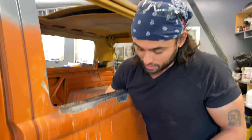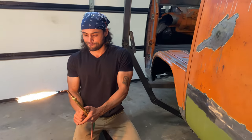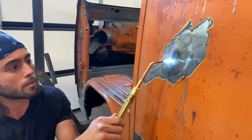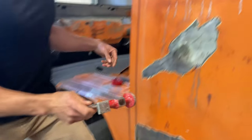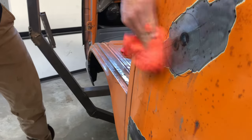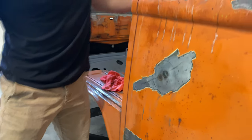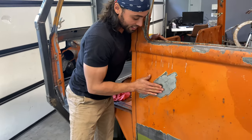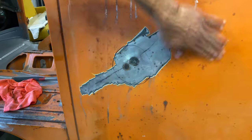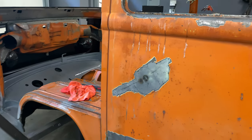It's a lot smaller now, and it's a lot harder — but now we're going to do it right here. Sometimes it takes more than one — I saw that online. It's not going anywhere. Now I'm going to look up how to use the hammer and dolly correctly and flatten this out. I think this will be best done with a spoon from what I've seen. It's not doing the pop pop, but that's still got too much oil canning. We'll work on it — I'll get it in a time lapse because this is going to take a while.